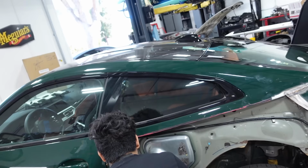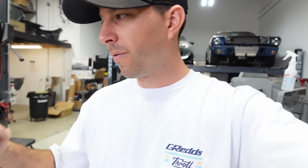One question we were thinking about, and I saw some comments on Instagram about it, is we're testing this with the battery disconnected, but when we connect the battery and the car is running, is the drop from the air jacks enough to set off the airbags? Which initially kind of scared me. I thought, oh my God, I think it might. Thinking about it farther, what sets off airbags is the crash sensor. The crash sensor, I believe, to my knowledge, is set off by physical impact, not by G-forces or movement or shake. Think about it: when your car's on track, you're going over rumble strips or whatever, that's a lot of vibration going through the chassis, that's a lot of G-forces, and the crash sensors don't trigger anything.